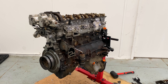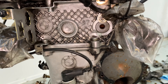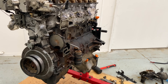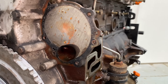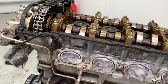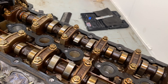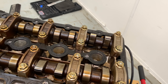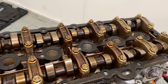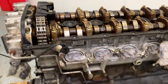So that is one stripped S50 B32. It's been nice to get it a bit cleaner. A lot better than it was. I've been able to unbolt a lot more of the stuff now that it was a bit cleaner — things like the water pump, the oil filter, and thermostat housing. Take a look at the camshafts now that I've got that open — all looks nice in there. Maybe a little bit more golden than you'd perhaps like. That might indicate an engine that's got quite hot, or oil services haven't been quite as common, but I don't think it's anything too much to worry about.